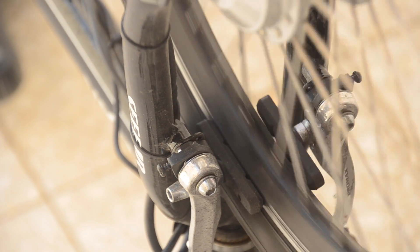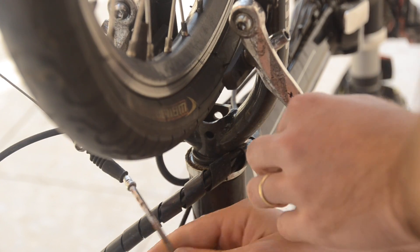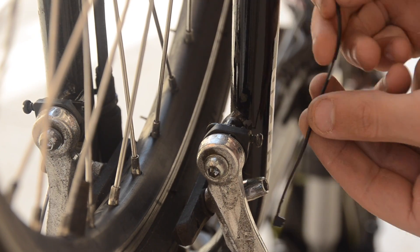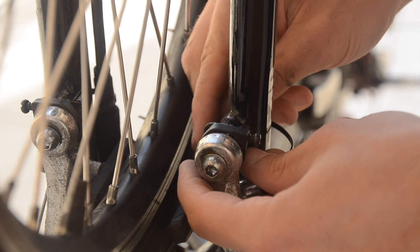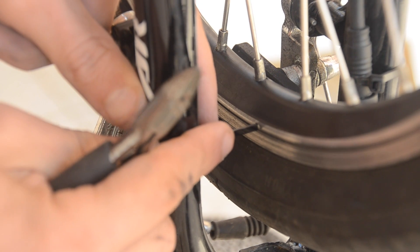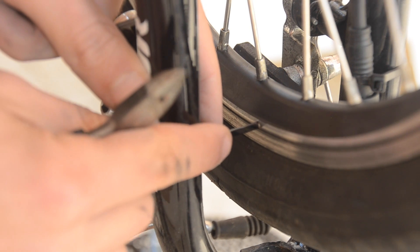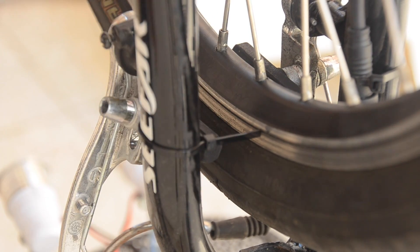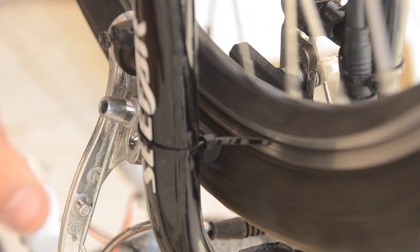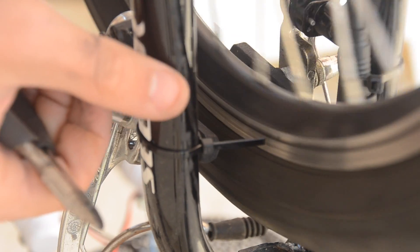If there's a lot, like in mine here, you're probably going to need to open up the brakes. Go ahead and open those up. Next, take a plastic cable tie and cinch it around the fork or the frame of the bike, and make sure that you have it lined up so that it's at the same height as the rim of the wheel. Cut your cable tie just at the point where it's touching the rim. Then you can twist it around the frame to adjust the distance from the rim. When you spin the wheel, it's going to act as a sort of depth gauge, so you can check how close or far away the rim is as the wheel's spinning around. This will let you see how far out of true the wheel actually is.